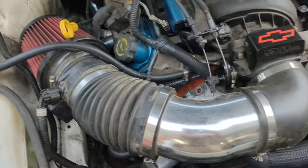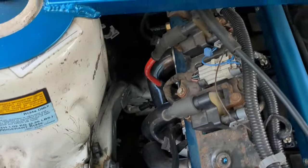What really helped the most was getting rid of the throttle cracker completely in the tune - just disabled it completely. Then there's throttle follower, and I dialed that back by about 75%, so there's only about 25% of what it used to be. That helped like hell too. So I'm thinking to combat IATs with this air filter right by the headers...